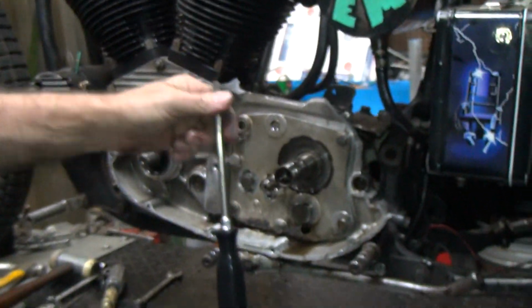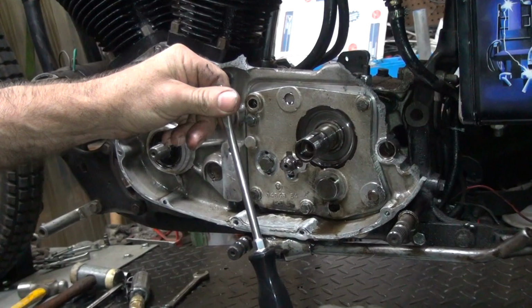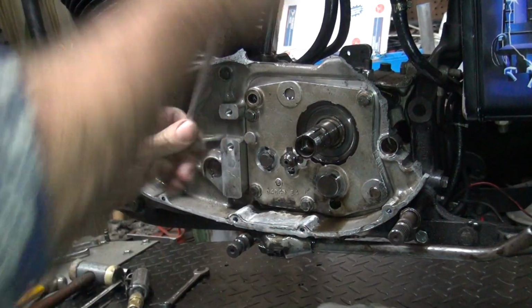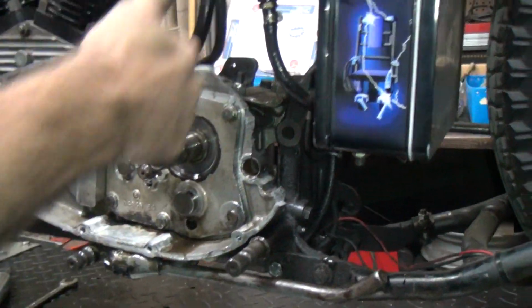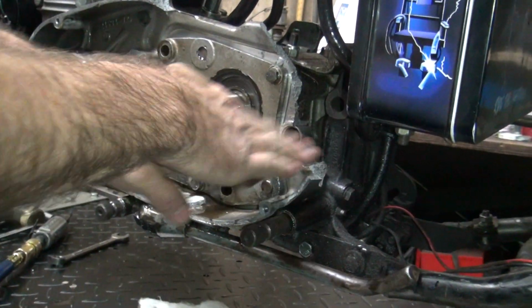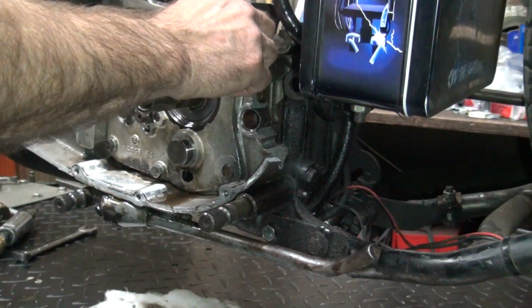You have to show like I'm doing, Fred. Well, so this is your kicker, let's say. When you kick it, if the motor runs back, when you bring it up a little bit, it engages the kicker gears and this goes whang like that real quick. And this pin right here is what stops it from going up. And that's obviously where it can go and separate. So that looks like what happened. He says that's not what happened, but that's what it looks like happened.